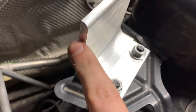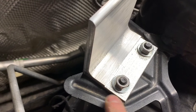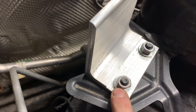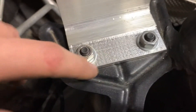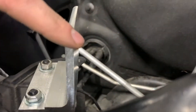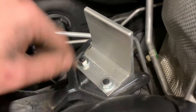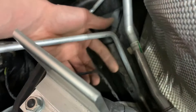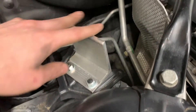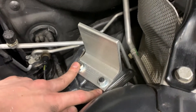On the other side of this, I can mount another L-bracket to go out this way, and the catch can can mount underneath that. That'll give me a three-inch lift above this surface, which I think will be just right. There's nothing below there, so the bottom of the can can drop out very easily. I think this turned out pretty good, considering it only took about 20 minutes.